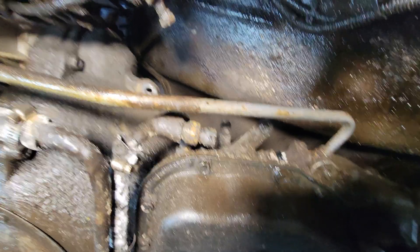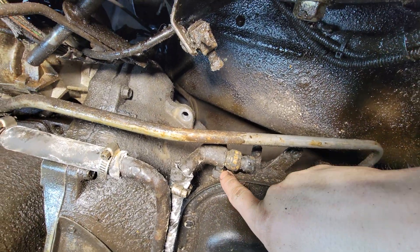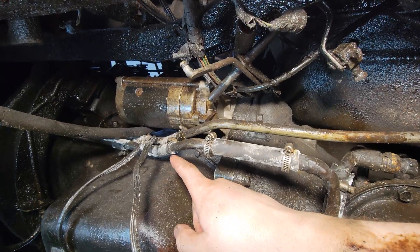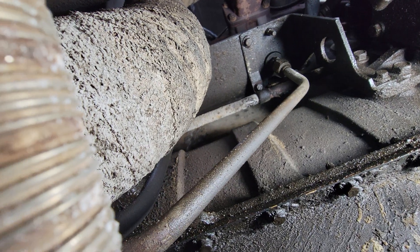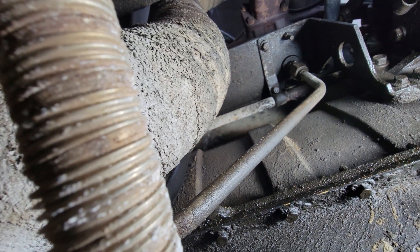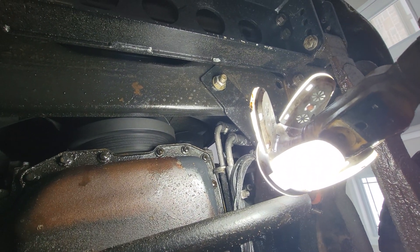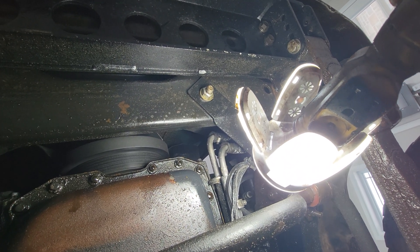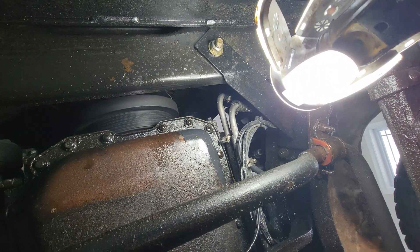The next thing we're going to do is remove the steel transmission lines. There's two that go directly into the transmission — the rear one and the forward one, which has a sensor in it. We'll remove them right off the transmission. There are a couple of brackets on the bottom of the oil pan that attach them to the pan. On the passenger side of the engine there are two steel lines that go up to the fluid-to-fluid heat exchanger — we'll remove those as well. The final connections are at the front, where those two steel lines go into two rubber hoses just up by the front of the oil pan. There are actually three lines: two go up front, two to the fluid exchanger, and one goes from the fluid exchanger to the transmission.